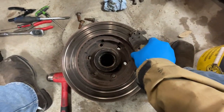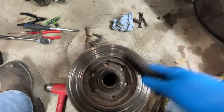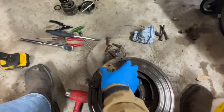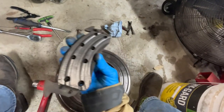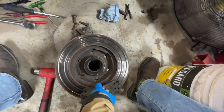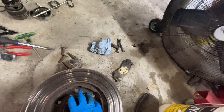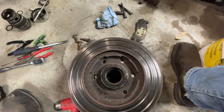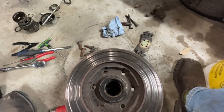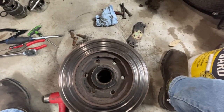The previous owner didn't want to go through the hassle of doing all this to change the rotors out, and that's why a pad went bad - the rivets ate into the rotor and now it's like a track in the brake pad. I used a hammer to knock the studs out and bought new ones. I'm probably going to press the hub out of the rotor since it's likely rust-welded in there. After looking at the bearing, I'll just clean it up, wash it in a little diesel or gas, get the old grease off, pack it with fresh grease, and she'll be fine.